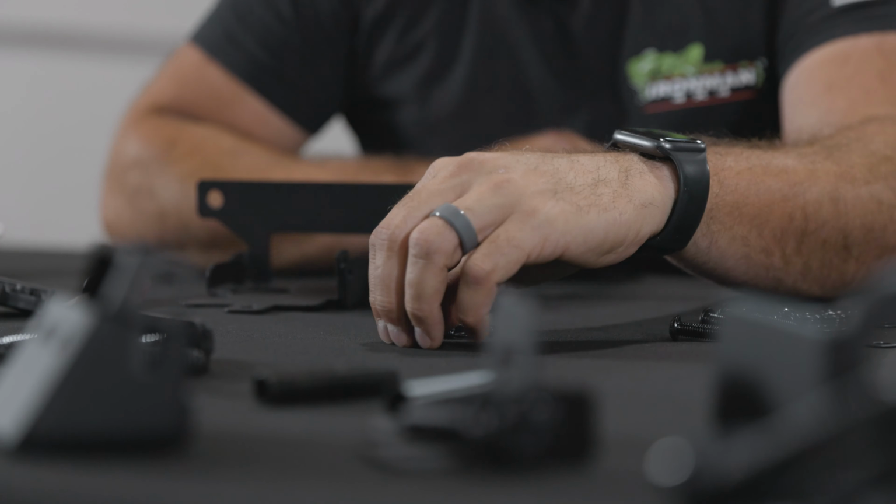So that is all on and locked down, and then we can rotate it back to where it is supposed to live. All right, now we can get these 1, 2, 3, 4 coarse thread 10 mils back on. That's what's gonna hold this louver at the top. Now we'll get our driver's side headlight in, start with the wire harness, click that in place, and then we're gonna try to line up this locating pin. It goes right back in there.